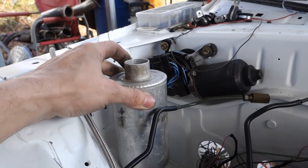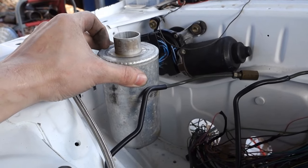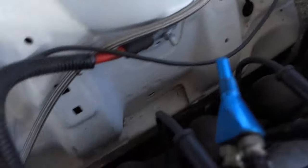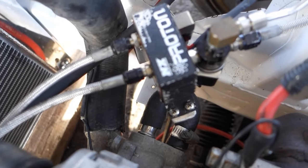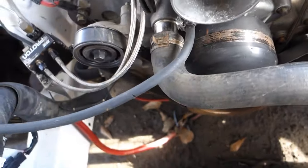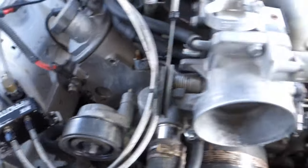Because that would definitely be the highest. Basically just cut this off and put a radiator fill neck right here. Have some lines running out the bottom right through here, maybe into the heater core in and out. I'm pretty sure that's what that's for down there. I'm not sure. Anyway, maybe something like that. And of course I'll have the, I think they call this thing the steam something. I have no idea. But it's basically to make sure all the air is out at the cylinder heads.